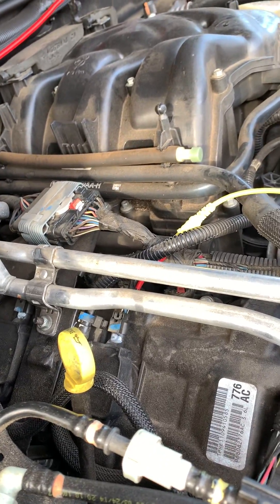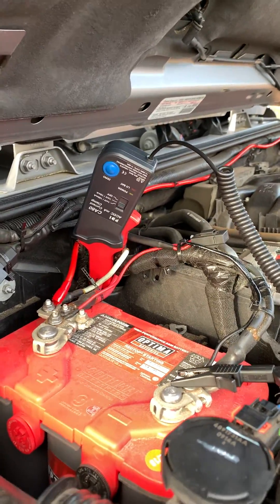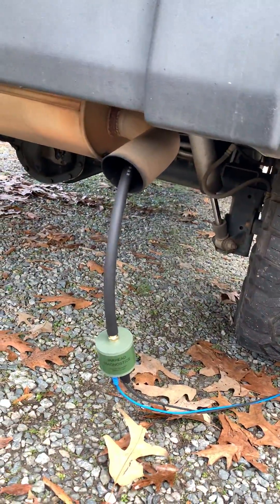Next, I'm plugged into my ignition coil, back-probed on the control side, to use this as my sync. Then I've got an amp clamp around the positive battery terminal for my relative compression.